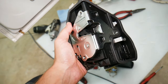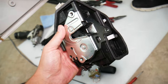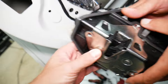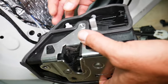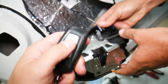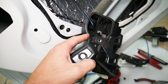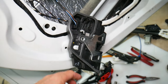Now, how do you know when they first start going out? Very often — not always, but very often — we hear here at the shop that you start hearing a strange noise when you lock or unlock your vehicle. We're going to connect the cable now and unlock the car so you can see what happens. Every time you lock or unlock — let's go in three, two, one — check this out. That noise right there? That's a bad door lock actuator.